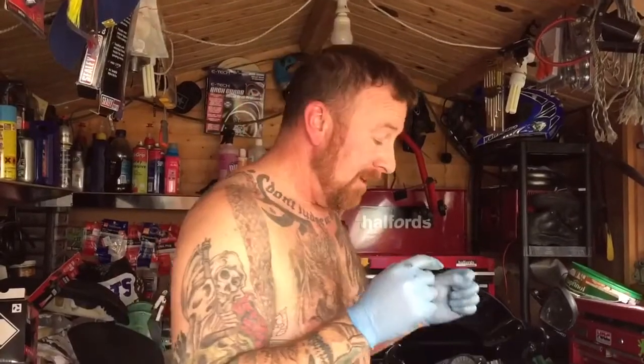When I've cleaned them all and put it back together, remember the little trick where the pipe comes up from the pump - use a little funnel and pour petrol in there to prime the carburetors. You can't suck them through like you do with peds. So that's basically it guys - check the other video out and this will be running.